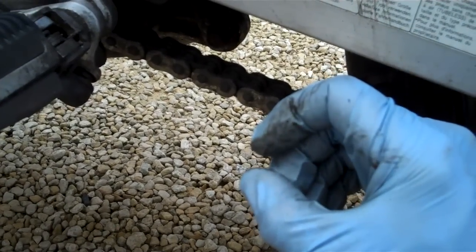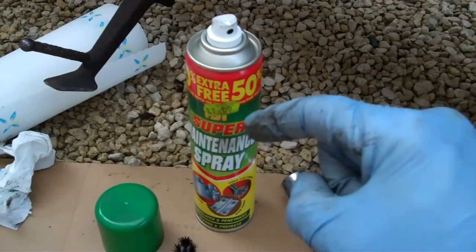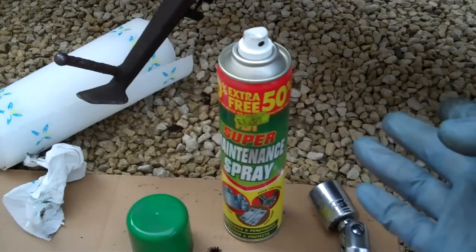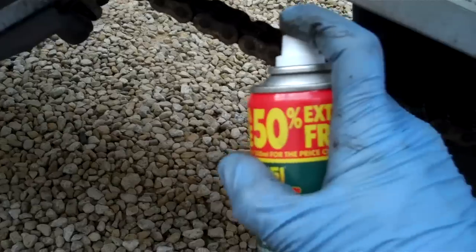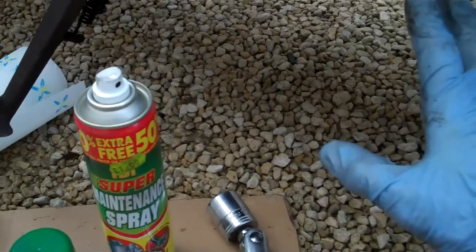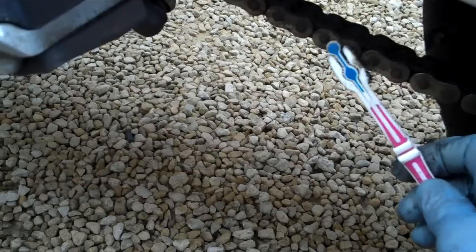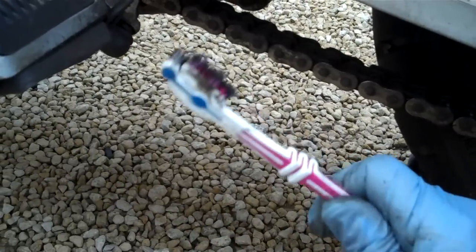As the rubbers dry out they shrink, water gets in, rust sets in, chain finished. Always use a releasant as opposed to a solvent — WD-40, GT85, Plus Gas, a whole myriad of different products. This cheap one from a local surplus store is oil-based, and when you finish spraying it on the residue that this leaves, the carrier propellant will dry away leaving an oily residue on the chain — which is good. You don't want to leave that chain dry. Use an old toothbrush and wipes because it's a bit gritty afterwards. Once the chain's nice and clean we can move on to adjustment and lubrication.